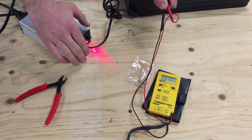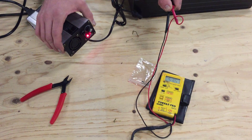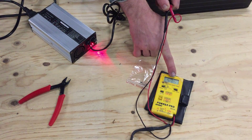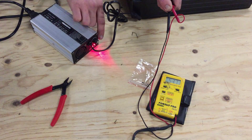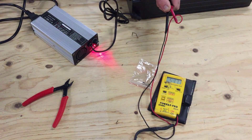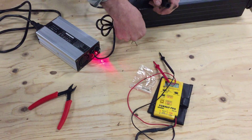There's another tenth and the fan's running. Both lights are red now — no green light — so this is going to continue to climb slowly. It's at 53.7. Eventually the fan will shut off, the light will turn green, and the voltage will probably be around 54 or so. So we know the charger is doing well.